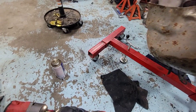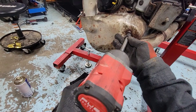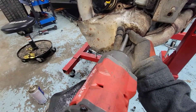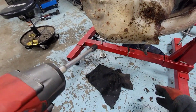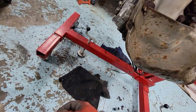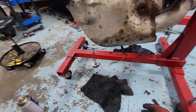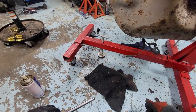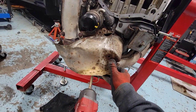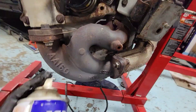Wow, there's always the big one — that's a 13. This one right here on the side, up on the front — 13 for sure. And then the last one right by the ground strap, that would be the 12 for sure. Manifold to head — there's three bolts right there.